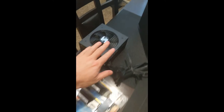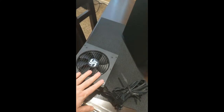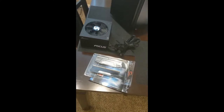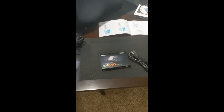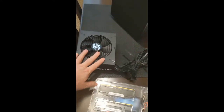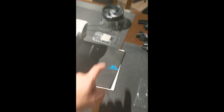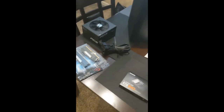Well, what's cool about that is that if I plug this cable into my power supply here, I can just every so often go and touch this. It's made out of metal. The power supply itself is grounded. So if this is plugged into a wall, even if it's not turned on, I can just touch this to basically short myself out to ground and ensure that I haven't built up any charge. Essentially, you as a human being are a giant capacitor, and everything around me is a dielectric that causes me to build up a charge. And the last thing I want to do is build up a charge, touch this thing, and fry the chip, and wham bam, I'm out $200 on that, which would really, really super suck.